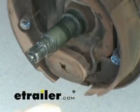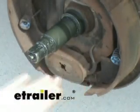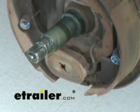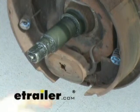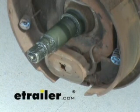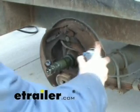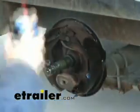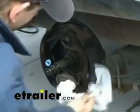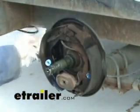The magnet itself has to wear down. If you look closely, you may be able to see some fine lines that look like wires — real fine hair-like wires going through there. When you start seeing that, it's time to replace the magnet. In this case we don't have that, so everything is wearing like it's supposed to. On this hub we just need to clean it up and repack the bearings. We'll clean up the brake pads and magnet with some brake parts cleaner, which you can buy at the local auto parts store — just douse it down and wipe it clean. You can also use it on greasy parts.